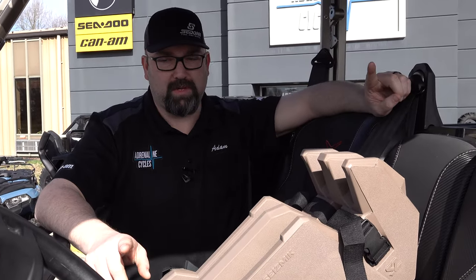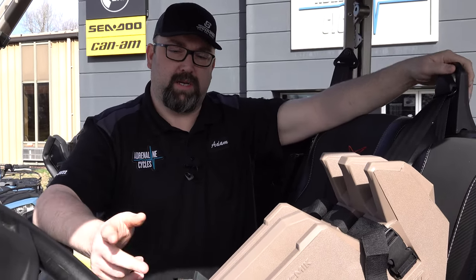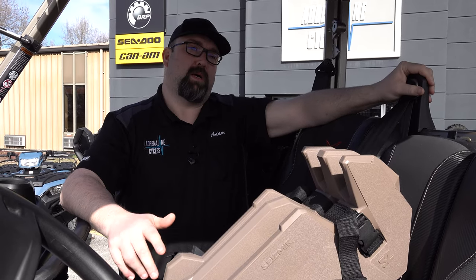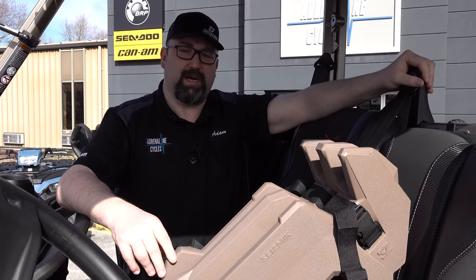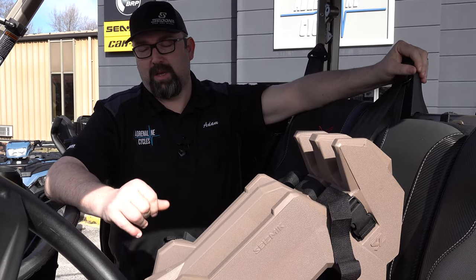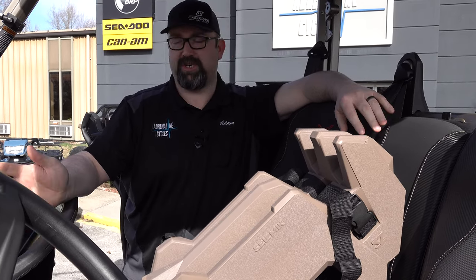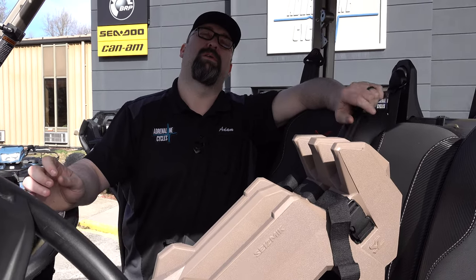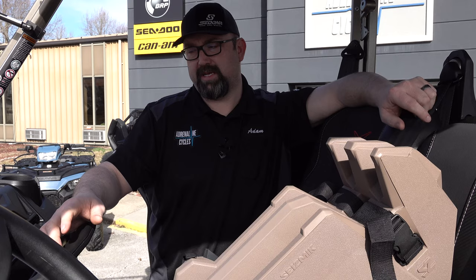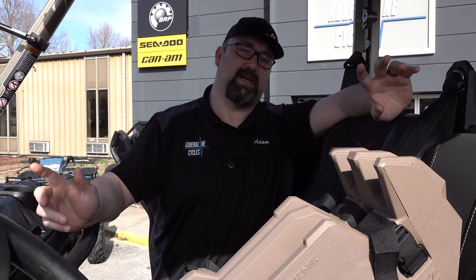One last thing I can't show you on here is it does have an EPI clutch kit installed. We got that from Highlifter — they do own EPI — so we got a clutch kit and the belt from them. Works really well, really quiet. Before in the past we thought EPI was a little loud, especially on some X3s, but they've changed some things on that setup and this thing is super quiet, engages really smooth. Even with the portals on there, this thing pulls out, doesn't try to get herky-jerky with this giant tire. The portal gearing is about 40% reduction on these, so it's not going to be super fast, but we went with what they recommended — always good to go by what the manufacturers suggest as far as tire size.